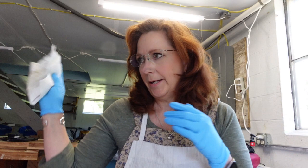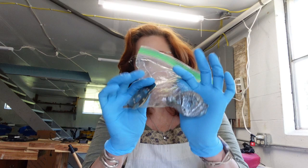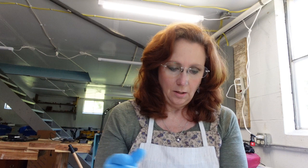I have the machine over in a big plastic tote with kerosene. The bucket I was going to use was too small for that machine. I'm going to let it soak probably overnight. In the meantime, I'm taking some time to start cleaning up some little pieces — slowly taking them apart, cleaning them up, and putting them back together. I'm still deciding how the finished product on this machine is going to look. There are a lot of black pieces, so I'm thinking something with black accents so I can leave those pieces their original color.